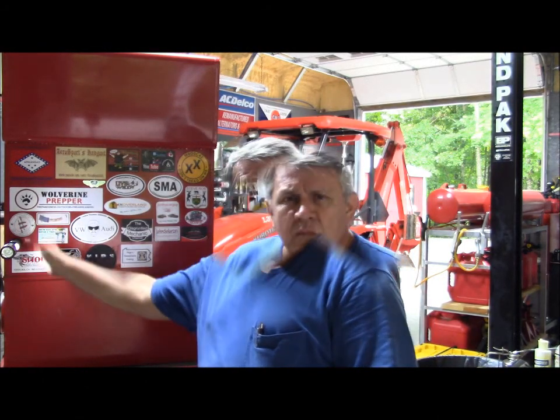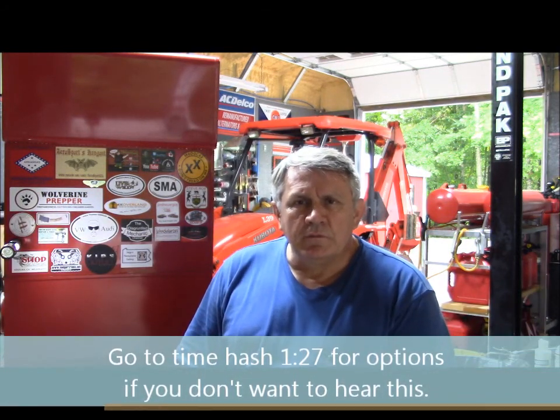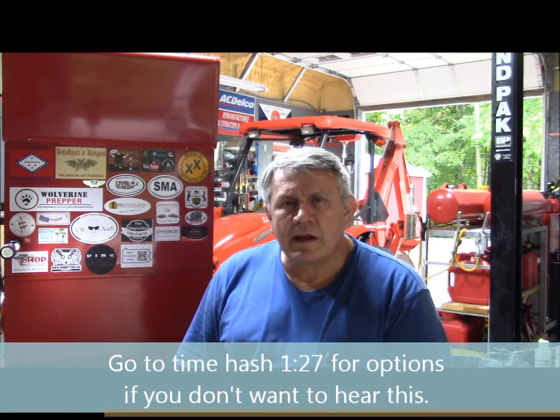But the real reason you're here is I've got a 1998 Chevrolet flatbed truck that you may have seen me change that alternator out on, and I've got a crank no start situation now. The only thing different between running and not running is I disconnected the battery to fix a horn wire that was broken, so I had to unlock the steering wheel.